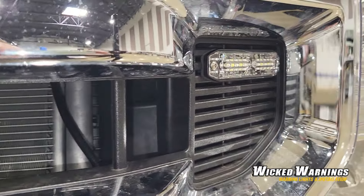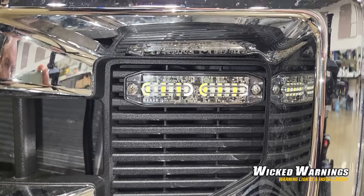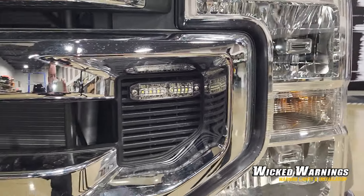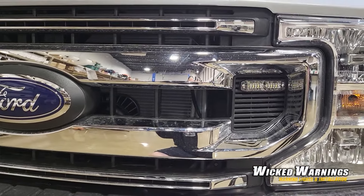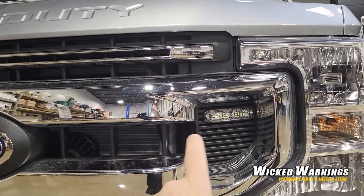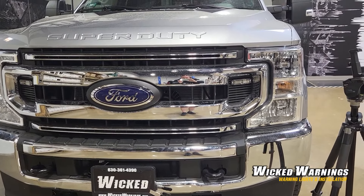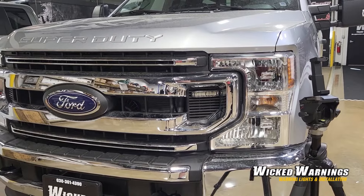As we go over this way, you can see our Thin-X. We did clip a little bit of the grille for the wire routing and drilled two holes into the grille bar to mount this. This Thin-X mount will leave a little bit of damage behind if removed, but this is a snowplow truck and it was okay because we wanted to put the lights out a little bit on an edge and down — because the snowplow headlights are going to be up in here. This puts that light down and out on a little bit of an angle so it'll actually be useful while they're running their snowplow.